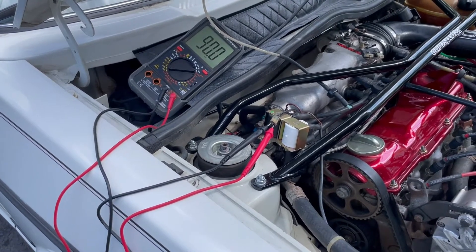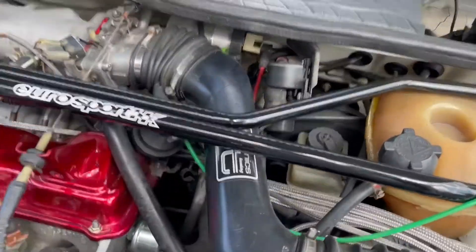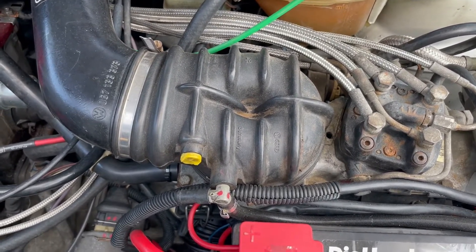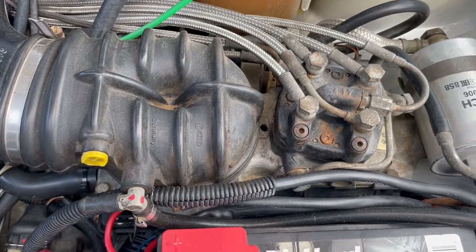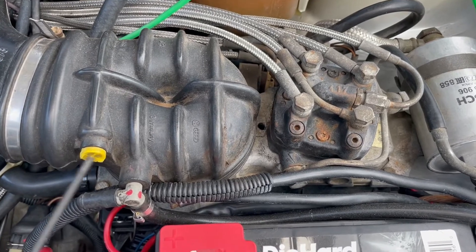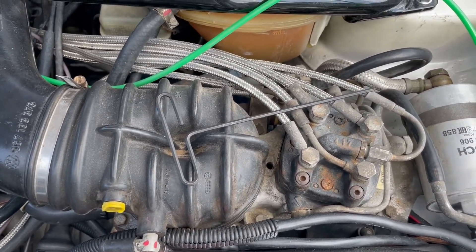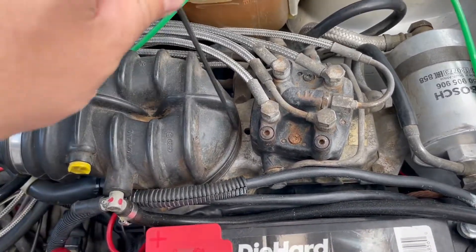The meter is connected and the car is warm. To make adjustments, go over to the air box and the fuel distributor. In between the boot and the actual fuel distributor there's a little hole from the factory — it has a small aluminum anti-tamper plug in it. If your car still has that plug, you'll need to drill it out. To make the adjustment you need a three-millimeter allen key. I have a particular long tool I got from Tectonics Tuning — I'll add the link in the description — and because it's super long, it goes right into the hole.